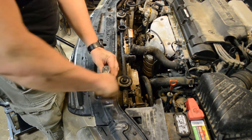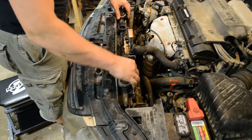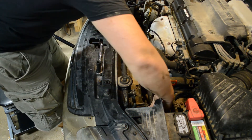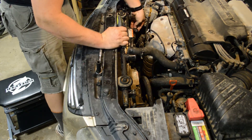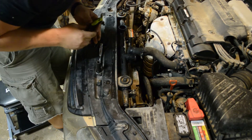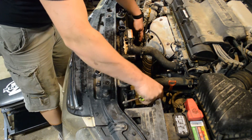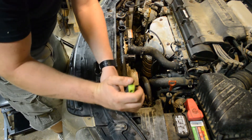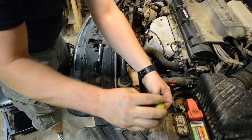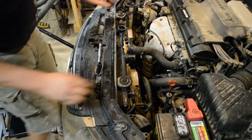For the upper mount bolts they're a 12 millimeter. We'll put those right in the tray. That gets the radiator loose right there. Then we've got a few electrical connectors to take out. You just pinch down on the button in the back and pull it out. Once we've got the two electrical connections off — the front one and the driver's side passenger side — we're going to take off this little valence that covers the battery hold down. Pull those clips out and dump them in the tray.